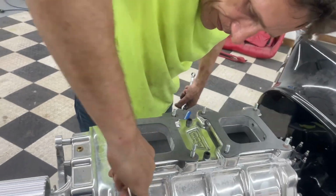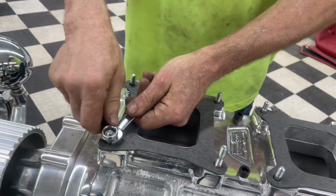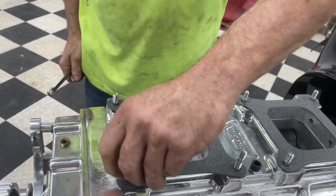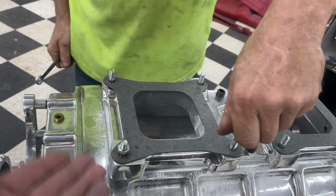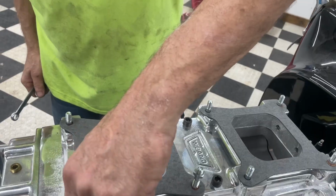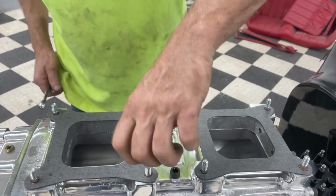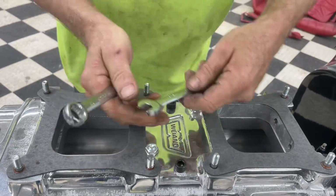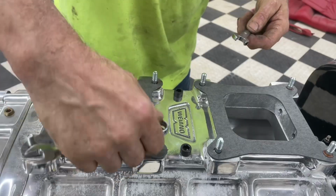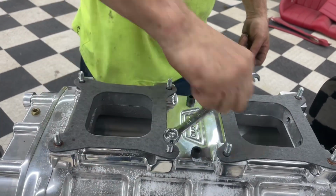They're putting this stud in with the old double nut lock nut technique. Some people might not know this, but if you put two nuts on the stud, tighten them up off of the thing so you're not jamming down on there, then you can tighten the whole thing in there. Then loosen both of them up a little bit with the wrench, then tighten them both together, and then tighten the whole thing down.